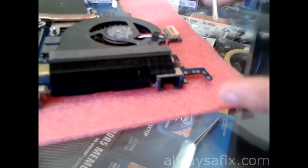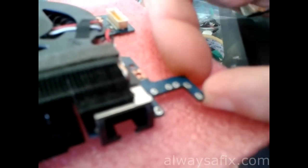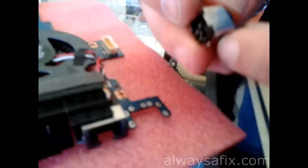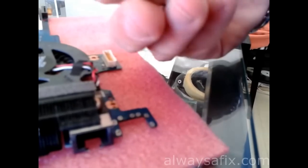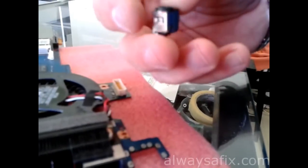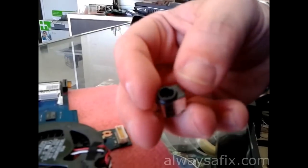The socket is attached here, and there's a very thin piece of motherboard here — just take care and don't force it. I reckon it would be quite easy to snap that off. You've got these four mounting points here and three contacts at the back, soldered on the top and bottom of the board. Take your time removing the socket. Use some solder wick to help remove the old solder, and if necessary, add new solder to some of the contacts and then try to take it off — that helps sometimes. Be careful, because if you snap that motherboard, that's going to be a serious problem.